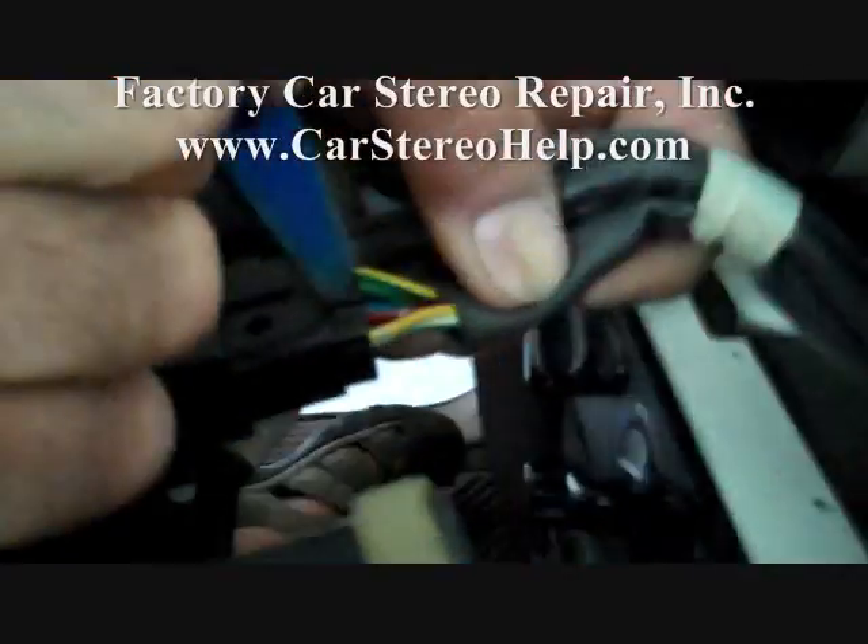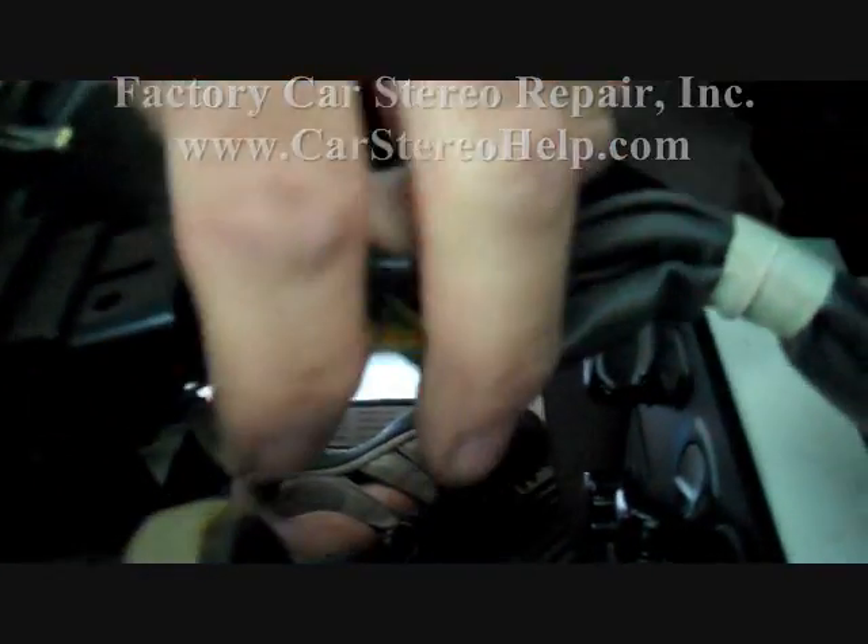At the top at the back we are going to push the trigger down on the top connector. This will disconnect the emergency flashers. Down along the side is another connector for the clock. We are going to move to the connector next to the clock assembly and leave the one remaining connector that goes to the air bag light.